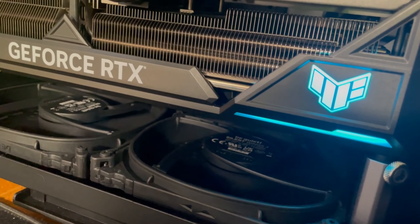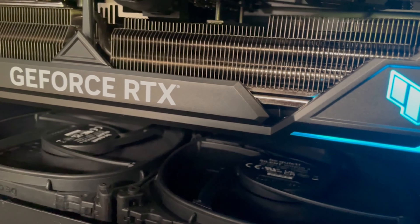Now let's see if coil whine is still present. As you can see, we do still have coil whine, and it can be reduced by choosing a really good quality power supply, or by giving the GPU some time to settle in with all the capacitors and running it at high frequencies and high frame rates for a while. However, I believe you won't be able to get rid of it completely — this is just how it is. High frequencies and high frame rates tend to cause coil whine, and I've even heard that new DDR5 memory with higher frequencies also has coil whine, which is just ridiculous. Be prepared that your unit might also have it, and you'll just have to live with it.